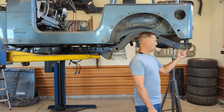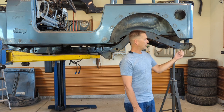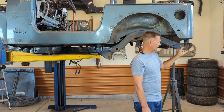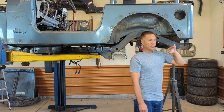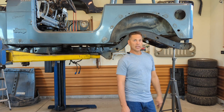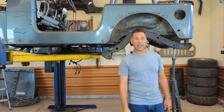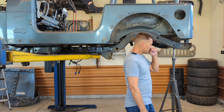This modification involves cutting off the rear of the frame and raising it an inch and a quarter. That's going to allow me to remove this body lift puck. With the frame raised an inch and a quarter, that effectively gives me a little more clearance on the bottom side of the frame when you're coming down on rocks. Every little bit of clearance you can get anywhere is huge — same reason I put these body mounts up another inch or better on the frame rail.